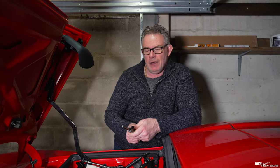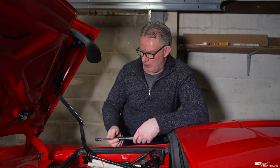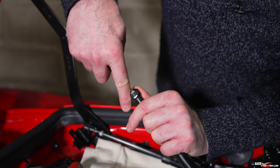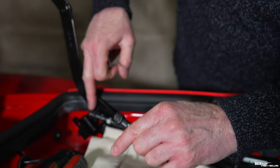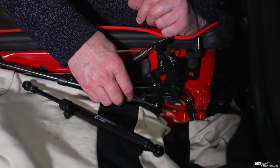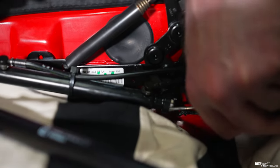It seems to be quite a simple job, but I'm learning as I go, and you'll be learning with me. There's a bit of a black art from dealerships about bleeding these, but from my research it seems straightforward. There are retainers here which hold this ball joint cup onto the ball joint, and this spring is a spring mechanism — you reduce the spring tension to enable the cup to open and lift off. I've already done it on this side so I know that works.